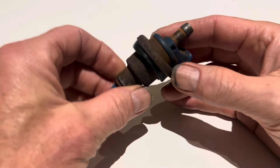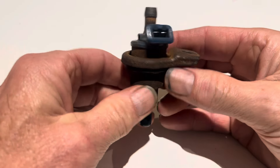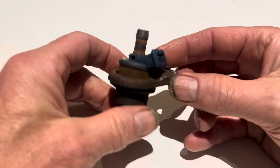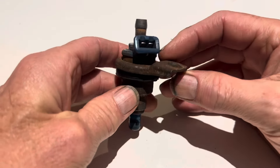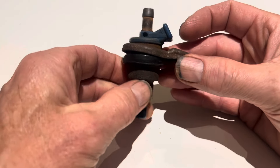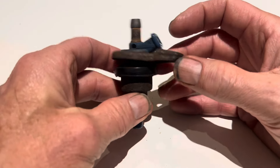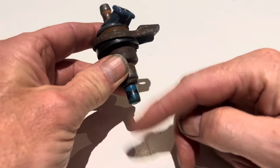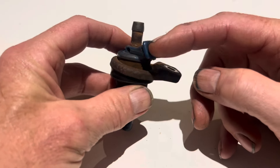This video is all about the Bosch fuel injectors used on the D-Jetronic fuel injection system on early Mercedes R107s, early Porsches, early Volvos, early Jaguars, and other cars. These are known as electronic fuel injectors or EFIs, and on the D-Jetronic system that fuel injection system was designed to run at a constant pressure of approximately 30 psi or 2.1 bar, with the only variable being the duration at which the injector is opened and closed, which is decided by the car's ECU.